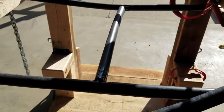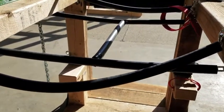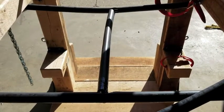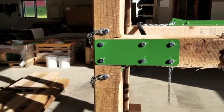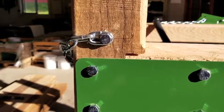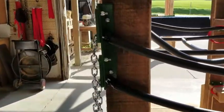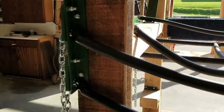You will also need to slip the chain through this rubber hose. There's one cross section here on the bottom — the part that goes underneath the horse — and those get attached just with a quick link. Very simple. The back chains will also need to be attached. You run a lag bolt through one of the links, just like on the front chains. The chains run across the back and through the locking mechanism, and that is attached with bolts and nuts, just like the front ones were.